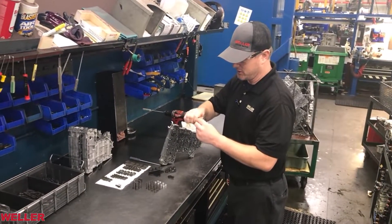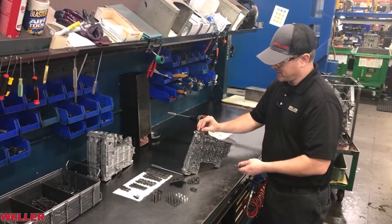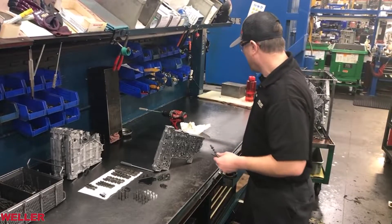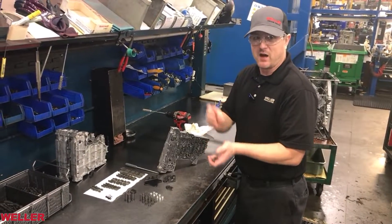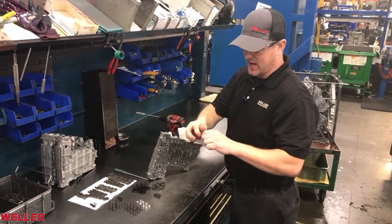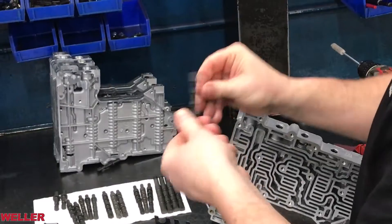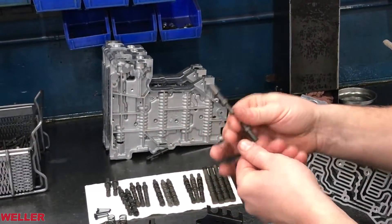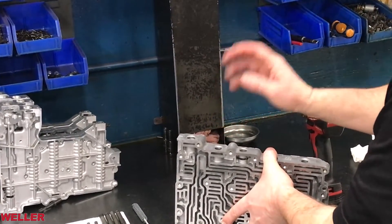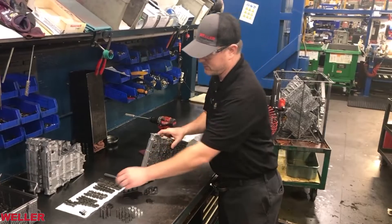I'm going to check another one — make sure there are no scratches and no dents in the valve. This one looks good, I'm going to drop it in. The valve should move under its own weight. If you drop the valve in and you have to force it in, it's not going to work. You can always use a piece of scotch brite and very lightly and gently polish it until it looks like new and there's no more scratch. Drop it in the bore — if you hear the ting and it moves under its own weight, it's going to work when it goes in.